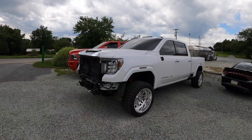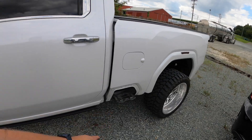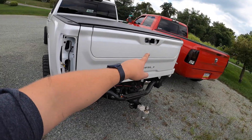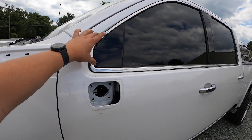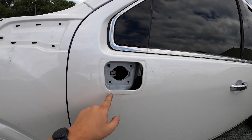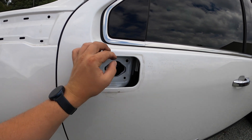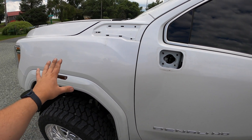We are all done with the disassembly. This is what a 2020 looks like with pretty much everything taken off — bumpers, grill, hood scoop, side badges, mirrors, bed steps, mud flaps, rear bumper, tailgate handle, and taillights. We primarily just have to work with the parts now. A lot of people talk about deleting the extended side mirrors, but these doors are actually aluminum — you'd have to have a piece of aluminum made, weld it in, fill it over, then paint the entire door and blend into the fender.